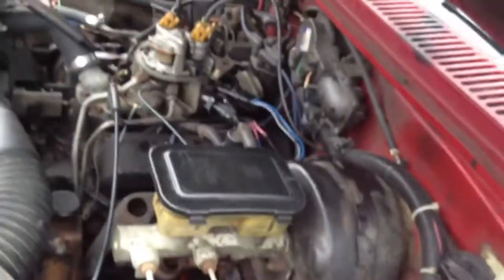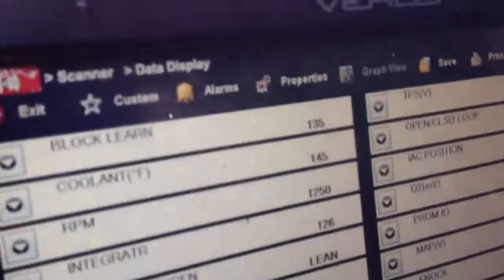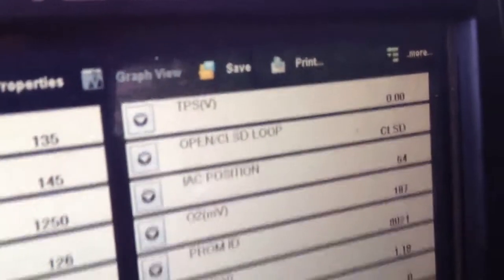The connector's new, TPS is new — well, it looks new. I don't know what else it could be. It's definitely TPS related because you can see it's got a high idle, around 1300 RPM, 1250-1300, but zero TPS. And when I give it gas, let me see if I can get it to do it.